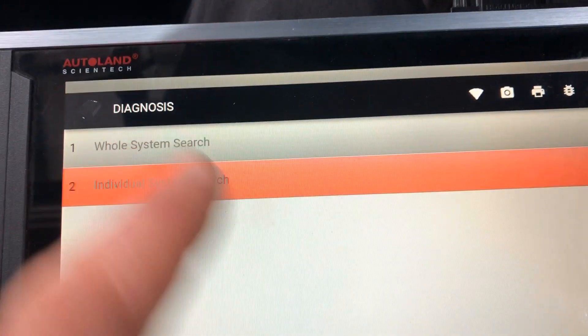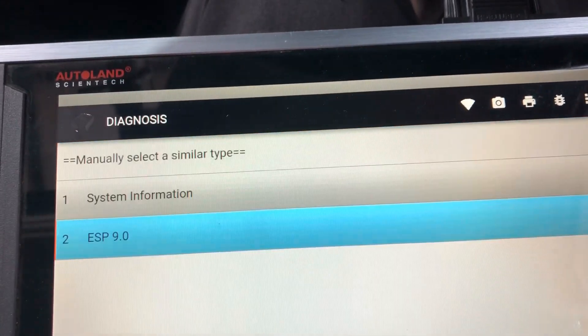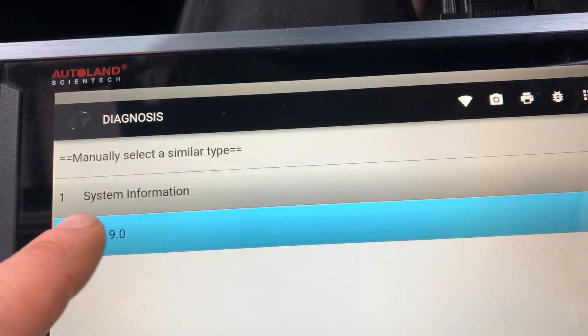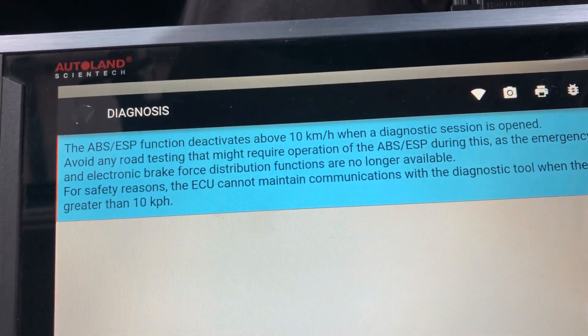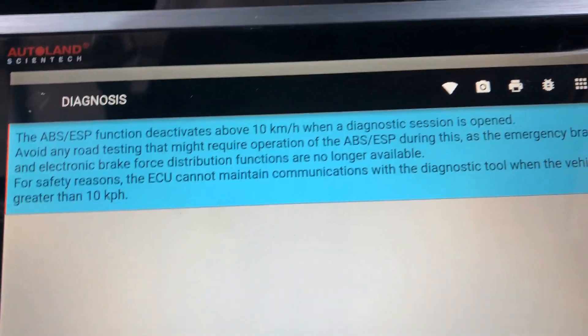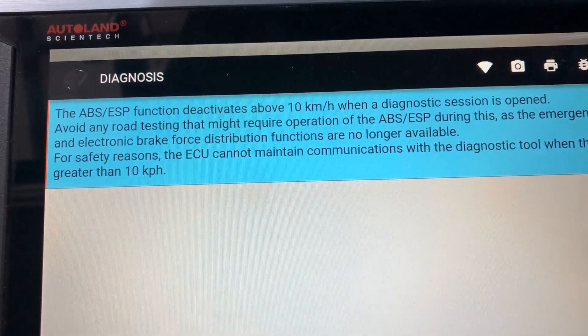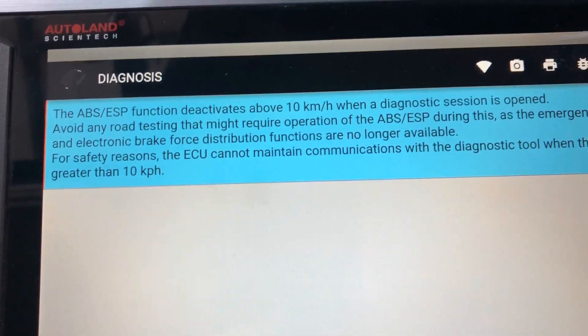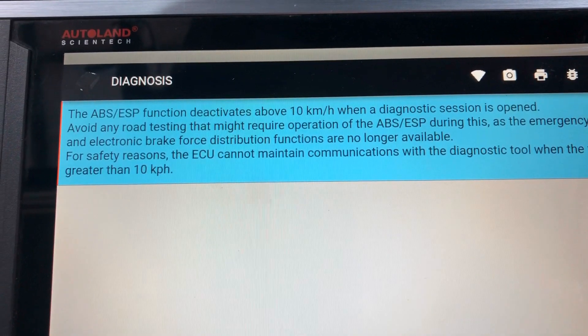This is an individual system chassis with anti-lock braking system and ESP9. Just make sure you have a battery charger connected, because sometimes there can be a high enough current draw when unwinding the calipers, so you don't want the battery voltage to dip too low during this, in case it can do damage to a control module or something.